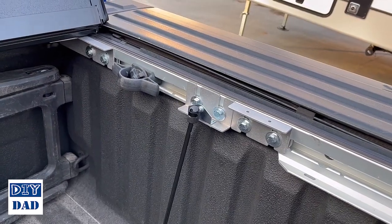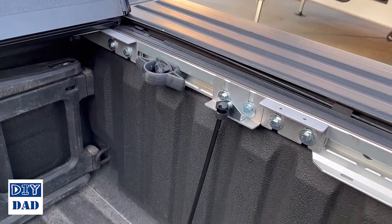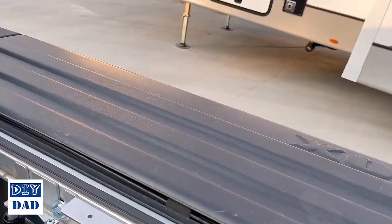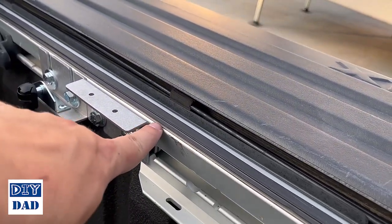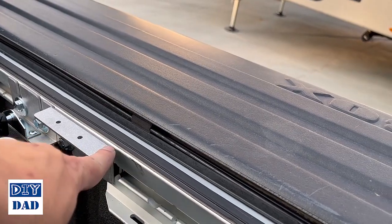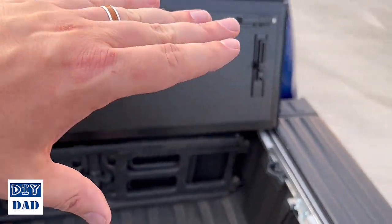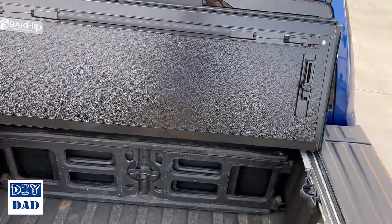All right, this first set of mounting brackets, if you're using the same spot for the pole supports that I use, it's going to have to be right up next to it. And you're going to want this top edge to run level with the top edge of the metal bracket here, but below the rubber, because you want the panel to sit and not touch that bracket. You don't want it resting against it, or they'll vibrate and it'll scratch this up.